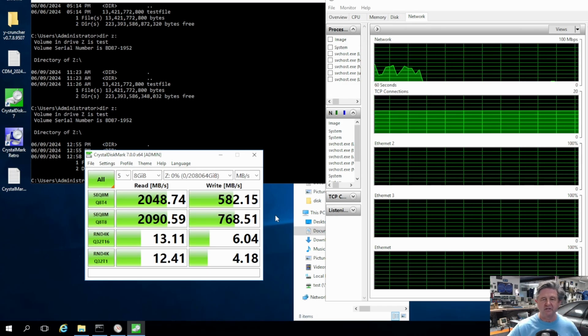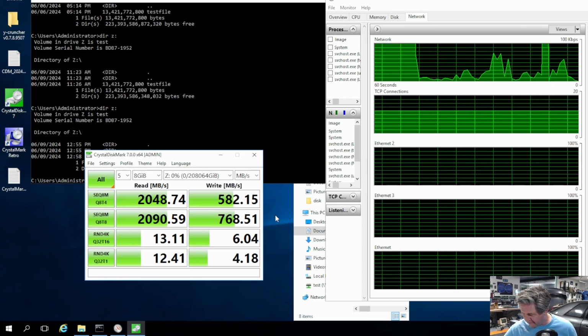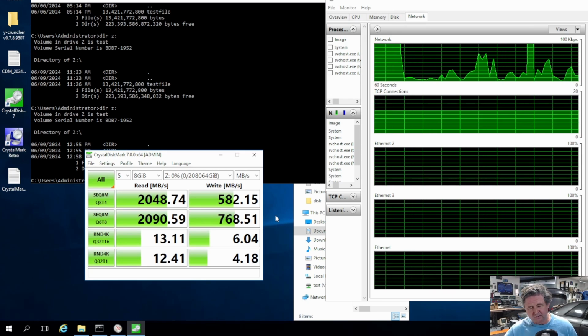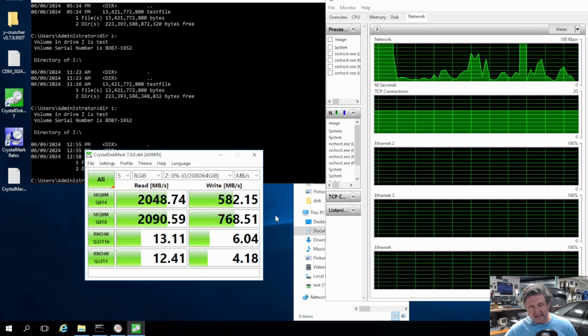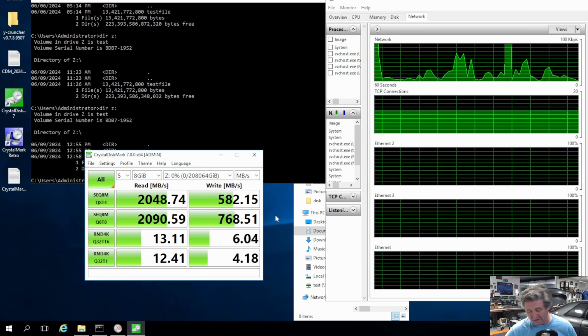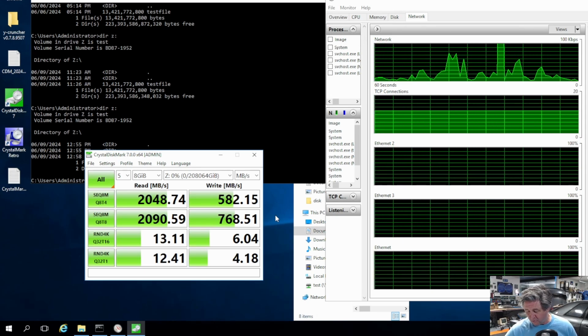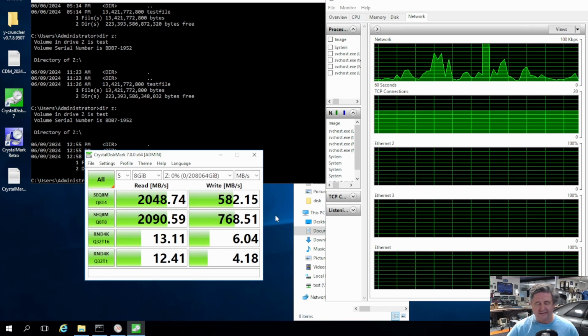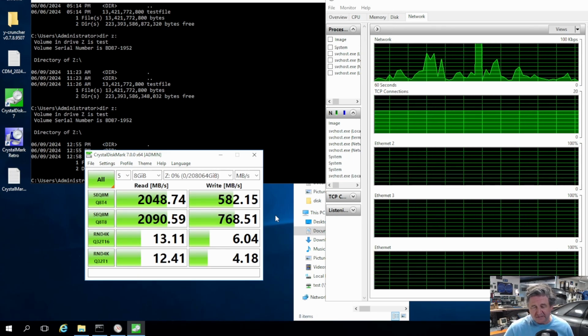So the numbers are about what you'd expect. Very similar performance, though, towards sequential write performance for RAID Z3. And the random performance, though, is where you see a good jump there. So 13 versus, we were at, what, 8 before with RAID Z2, so with only 2 vdevs. So adding an extra vdev added about what you'd expect in random performance.